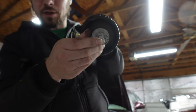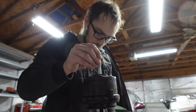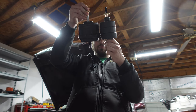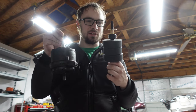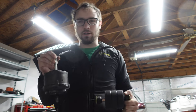So this is our old motor mount. We can see it's already cracked down here — it's been pulling loose, and there's no hydraulic fluid left in it. Here is our new motor mount. Roughly the same height; I might need to add one more hockey puck in there, but we'll see. It's going to install... I guess I'll put it like this. We'll find out.